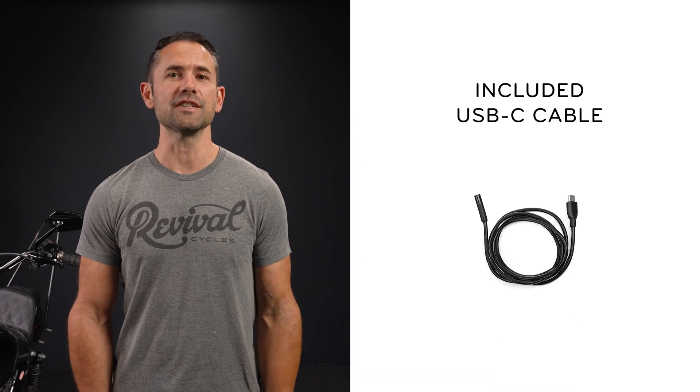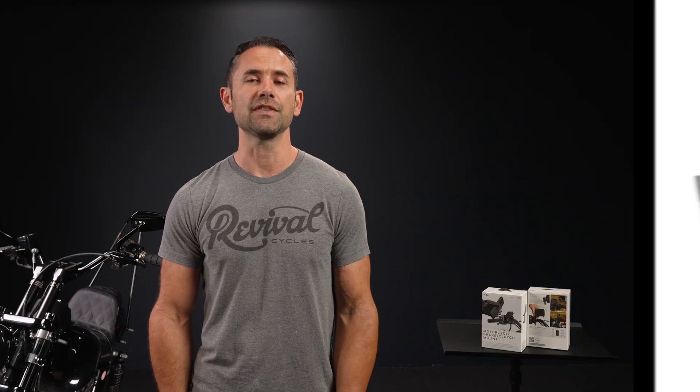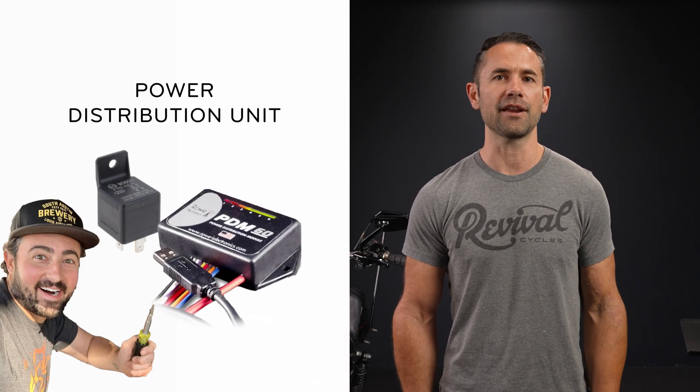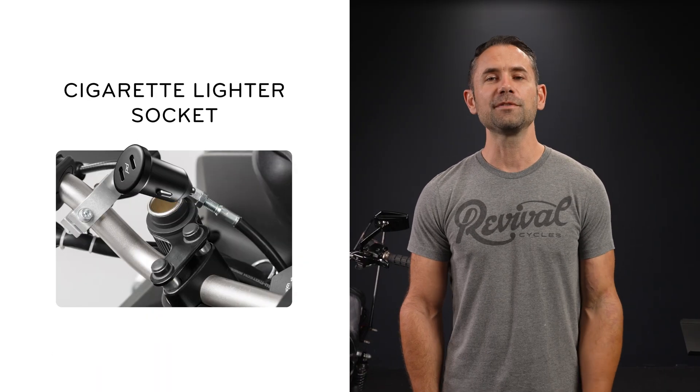Now, let's get to plugging it in. Your charging Moto Brake and Clutch Mount ships with a USB-C cable. If you need a USB-A or SAE connector, we sell those separately. Just note that the SAE connector should be attached to an ignition-switched SAE port — it should not be directly attached to the battery. If your bike doesn't have this already, your mechanic should be able to install one via an ignition-switched relay or an aftermarket power distribution unit. Or you could do this on the weekend with a couple of cold ones — cold ones not included. If it has something else like a DIN connector or cigarette lighter, you'll need an adapter. We've linked options for those — some made by us and some not. The ones made by us are better, of course — in the description of this video.